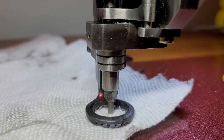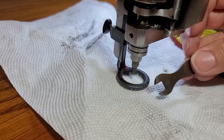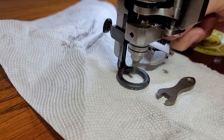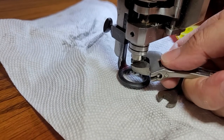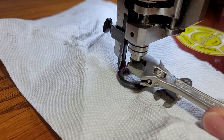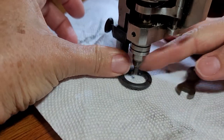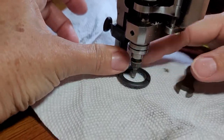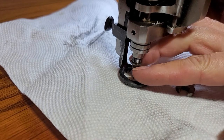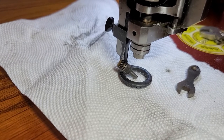I'm going to pause the video and pull out the nipple and needle and take a look. To take off your nipple, you can use a nipple wrench or a little crescent wrench — it doesn't matter which one you use. The nipple right here is a square thing, so you just put your wrench on it and unscrew it. I'm loosening mine, and now I'm going to unscrew it with my fingers. I have to take my needle out from the top, which I haven't loosened yet, because the nipple won't come off with the needle in the middle of it. So I'm going to loosen my needle and pull it out.